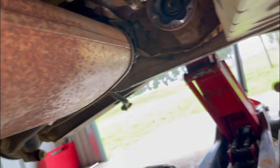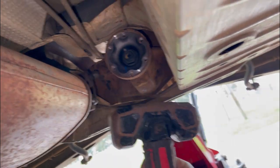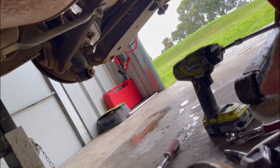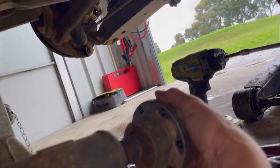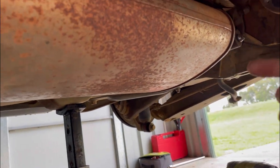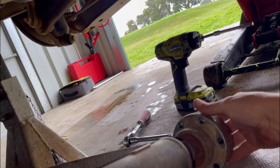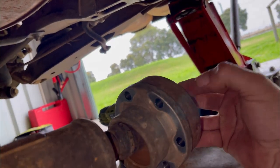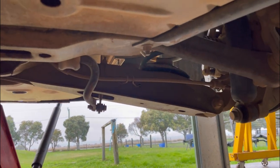The tail shaft can get a bit stuck in the diff. All you do is get a little bar — you can use a smaller hammer — just a bit of gentle persuasion. Just hit around the CV boot here and spin it. Put the car in neutral and spin this around, just tapping it all the way around as you're spinning it, putting some pressure on it — pull it and tap as you're hitting it around. That's all it needs; you don't have to go whacking it and it'll eventually pop out. They just get a bit seized in there. Now I'm just going to put the phone down and start undoing these bolts and getting this ready to drop down.